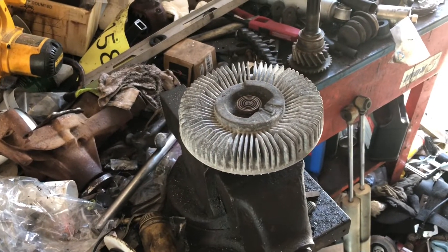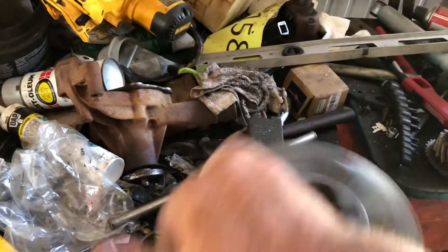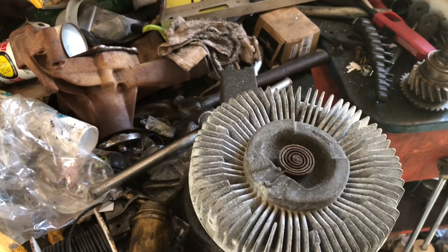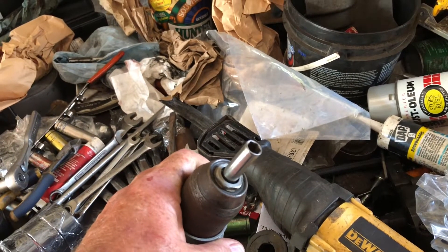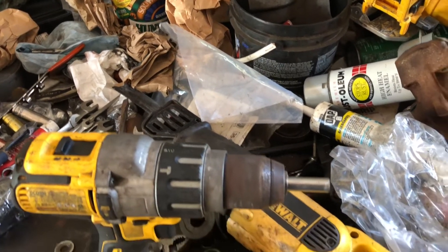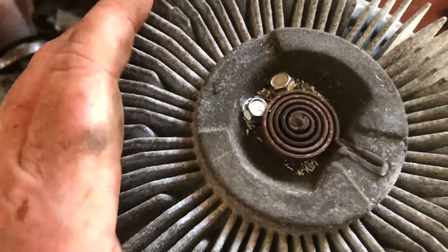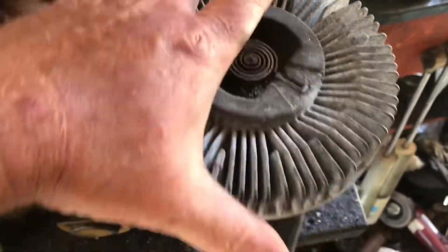Alright, I'm going to try to demonstrate what I was talking about earlier — locking the fan clutch up permanently with some screws. This thing right now, look, it just kicks out — it's garbage. So I'm going to try the screw trick and show you what I'm talking about. Little tip: a quarter-inch drive socket with an electric drill that has a half-inch chuck — you put that sucker right in there and tighten it up, nothing else needed. You've got yourself a nice big nut driver. So I got those two screws rammed in there — I'll be honest, the first one wasn't quite long enough, but this one was longer.